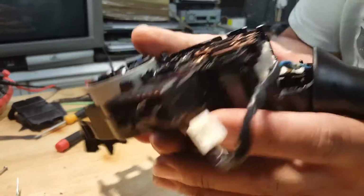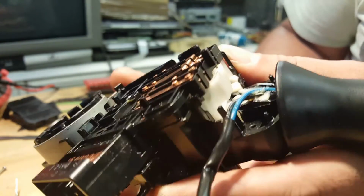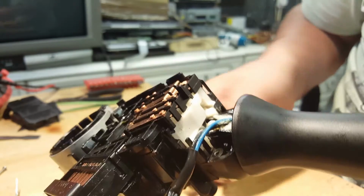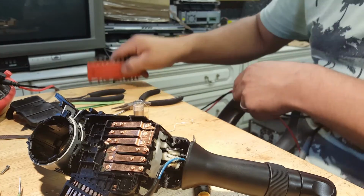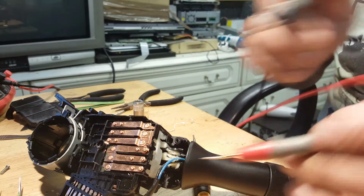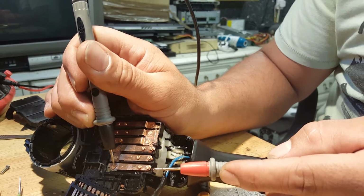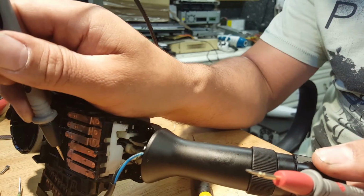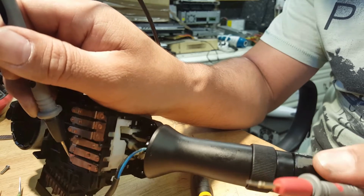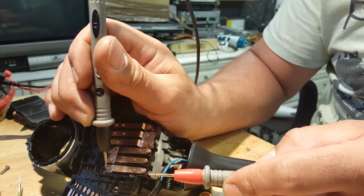So I put it all together now, and this is what I want to show you. This first plate here now is making contact, and to prove it, we're gonna measure the circuit. You're gonna hear the beep from the continuity, so we're gonna check this plate against the base in there. Hang on, let me turn the side lights on. So it's making contact now.